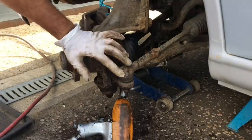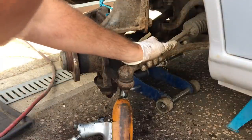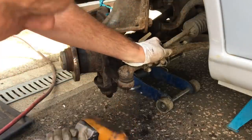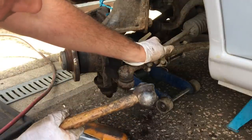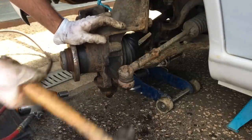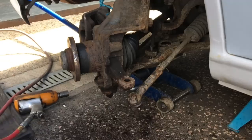Just a little how-to when removing a track rod end, whether you're replacing it or just removing it to do other work. It's always a good idea to give the nut a spray a good 10–15 minutes before you want to remove it, especially on a vehicle that's stood around as long as this. I had soaked this previously. Rather than trying to hammer it out or using any kind of fork or press-type tool, because it's on a taper, simply give it a few hits and out it pops — and that's it.